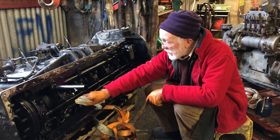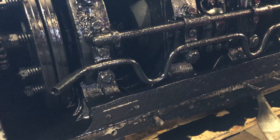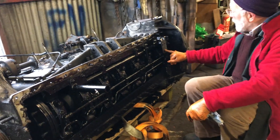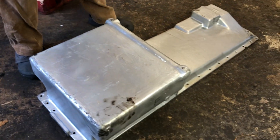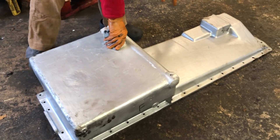The pipe that's feeding the mains is here — it's the same as it was before. This little thin pipe here is a scavenger pipe back to the pump, as before. The pump is quite different. This is the pickup for the scavenger here in this one. If you take a look at the sump itself, you'll see the first thing you'll notice is that the sump pan is a lot bigger — it's a lot bigger on a front pan sump than it is on a conventional rear pan. And the scavenger sump is also a lot bigger.